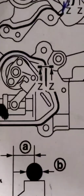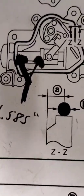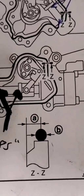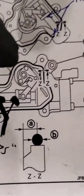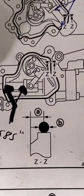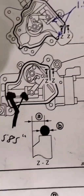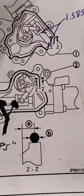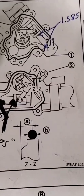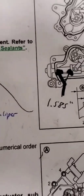That's with the two 6mm Allen head bolts loose. You rotate the motor, putting it into multiple positions. If you don't have this fundamental mechanical setup of how the VVEL system works - say you had to take off the tower system, re-liquid seal it for a leaking spark plug hole, or had the VVL motors replaced - you have to do this. If you don't, it'll never work in any configuration. You can bolt it back together all day and it'll never work; you'll never get the sensors within range.